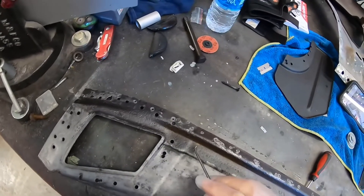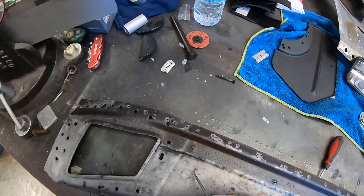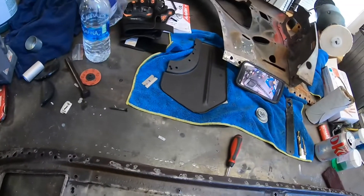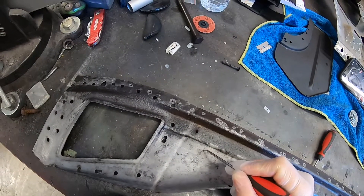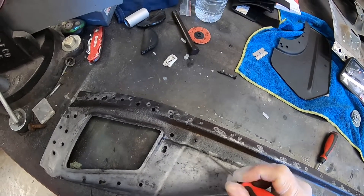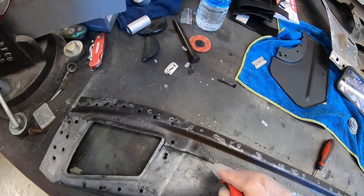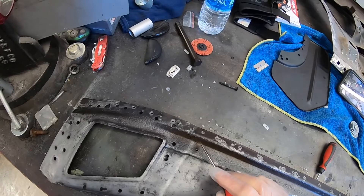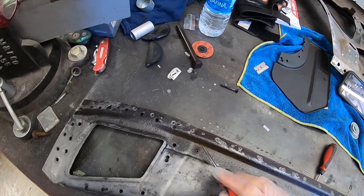Like I assumed before on my other panel — and it is. This light stuff here, it's gone, it's done. You just scrape that right off. So there's no orange under there — it's neutralized the rust. But in some of these deeper pitting areas it's still there; it just neutralized the top of the rust. However much I put on, it soaked into the top of the rust and didn't go all the way down into the pit. That's something to be aware of when you're doing this.